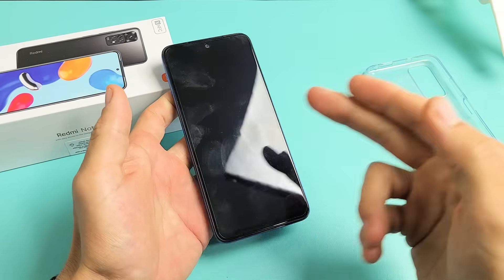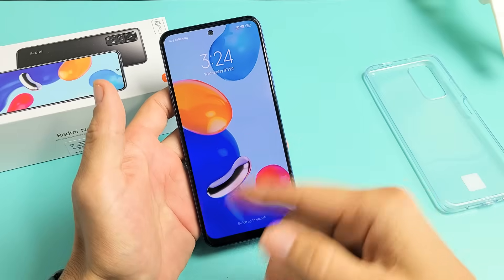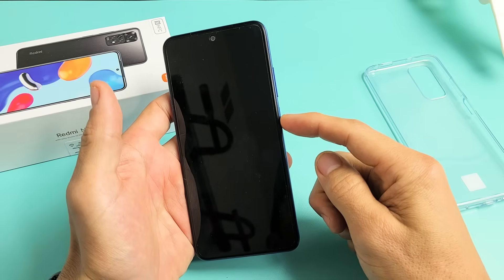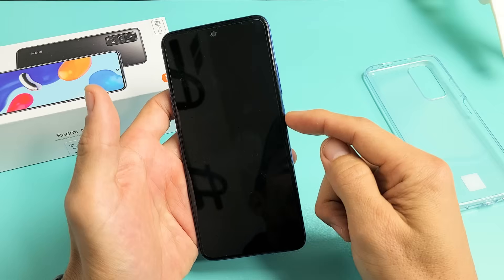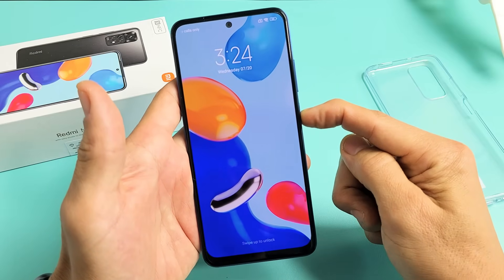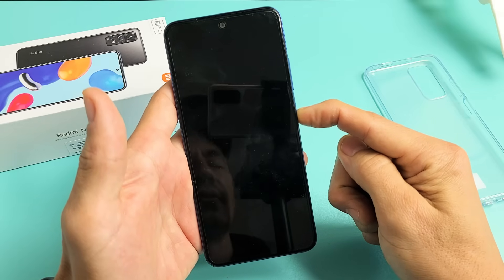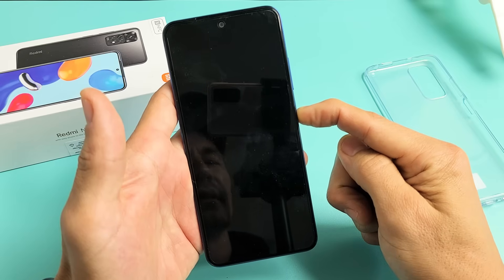What we want to do is force it to restart. So let's pretend that it's constantly restarting — I'm stuck in the boot loop, it keeps restarting right now. What you want to do is press and hold that power button and do not let go until we see the Mi logo appear. Press and hold, pretend I'm still stuck in the boot loop, just keep holding until you see the Mi logo, then go ahead and let go.